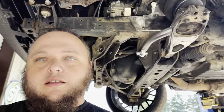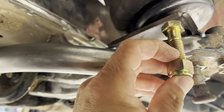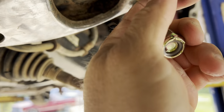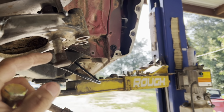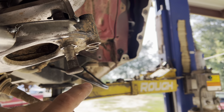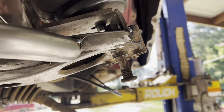The radius arm rod kit comes with a bolt that's four and a half inches long, but it was too long for us. We got a bolt that was three inches long because when you put all the tabs and everything together, it was hitting this bolt and we can't have that. So we got the right length bolt. I also picked up some half inch by two bolts to replace these bolts, because we're not going to have the radius arm bracket that was on top of it originally. So these studs were actually pressed into the radius rod. We knocked those out so we could use them to hold a ball joint in place just for mock-up, then went and got the right length bolts for that.